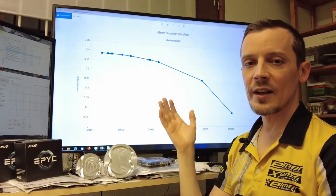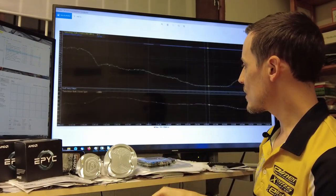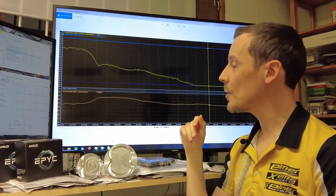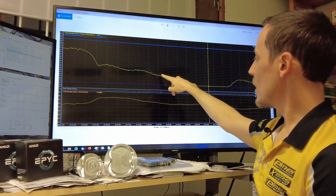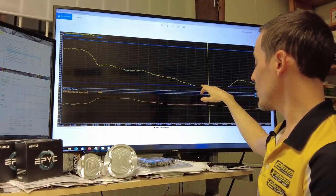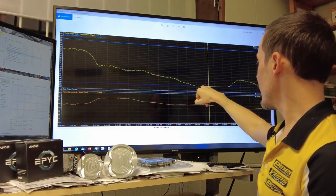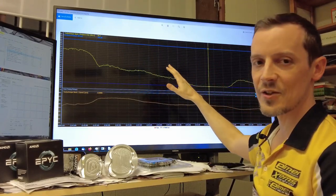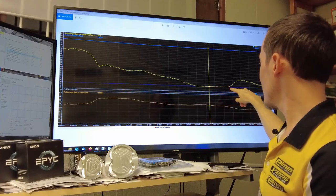This is the amount of air you can get into the engine. Let's look at some comparisons — these aren't the newest values, but from a chassis dyno pull. This yellow line here is the turbocharger choke pressure at the restrictor before the turbocharger compressor. You can see a straight line here — we're basically on the limit. This is from a slightly censored dyno map, so I'm not showing any RPM, but in this area we're on the choke limit.